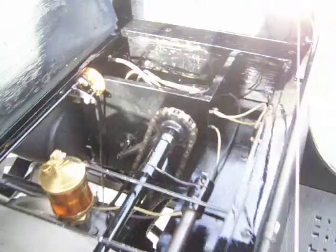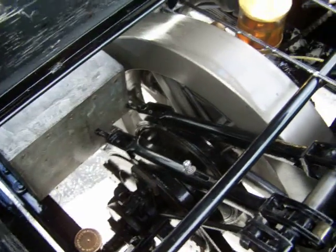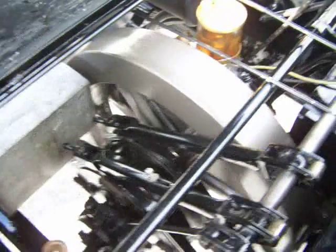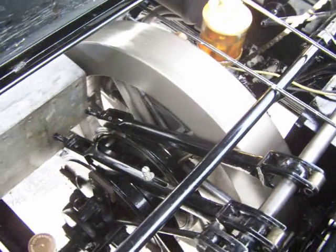You have your oil can down in here because your transmission setup needs to be oiled constantly. It gets real loud and chatters if it's not oiled properly. There are little holes in the sides of those discs to oil the planetary gears inside of them.